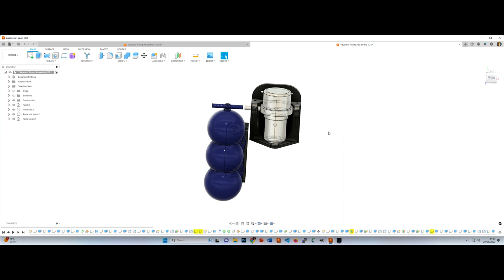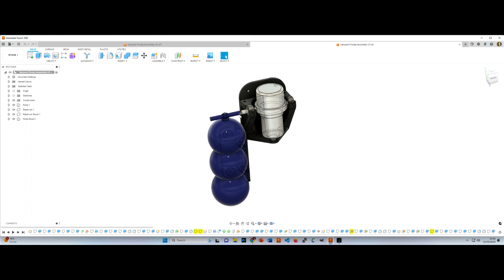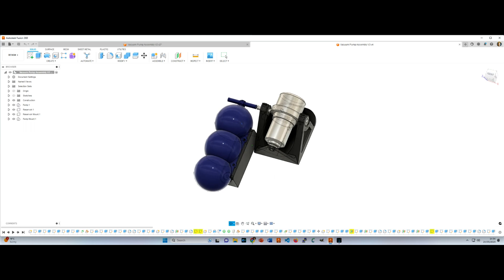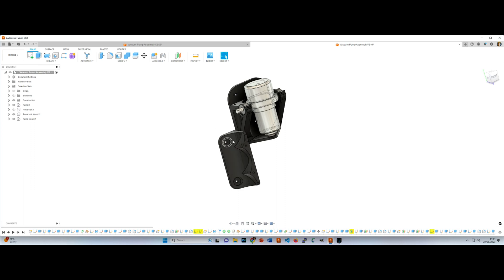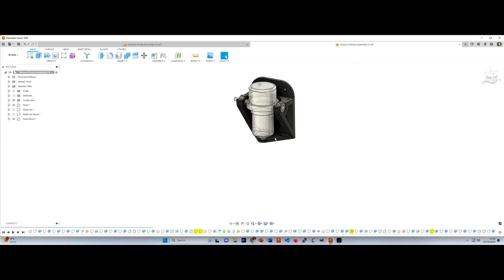I could have printed it solid but I just decided that the whole thing was probably a stupid idea. Version 2 looked like this. What you can see here is a couple of different things. This is an Audi vacuum reservoir in which I've removed the original barbed piece — it has a single barbed piece coming out of the top of quite a small diameter. I've swapped that for a 10 millimetre T-piece that goes off there.